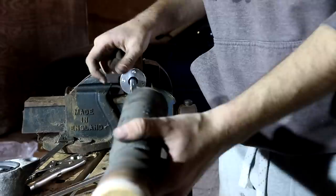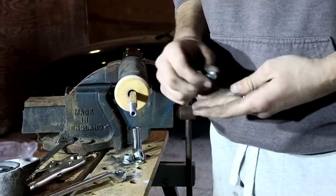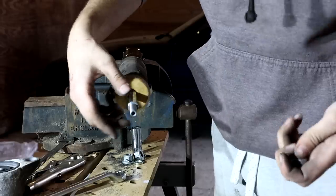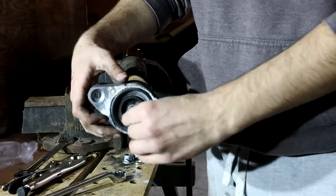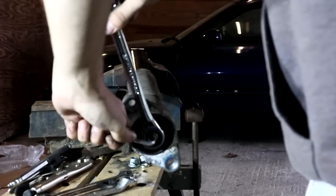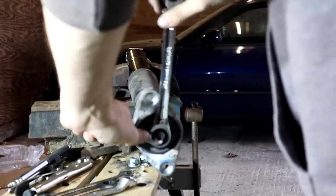Tear it apart, pop the little dust cover bump stop back on first. Then you need that spacer that Raceland provide. Then you put on the top mount part, then the bolt and the nut. And the nut screws on and does up exactly the same as the fronts with an Allen key.